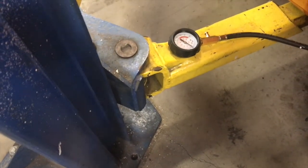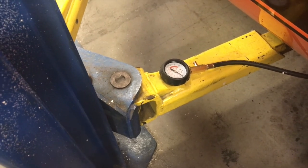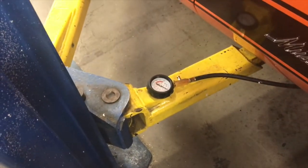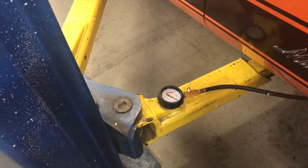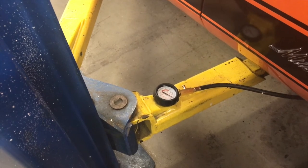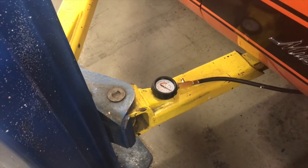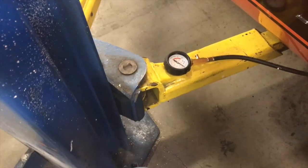Normally for these things we would put a special block where the throttle valve cable is on the driver's side of the carburetor. When the engine is warmed up and idling in neutral, we look for 35 pounds of pressure or more. In my case, I wanted to increase the shift point speeds, so I increased the throttle valve pressure and never bothered measuring what it was.